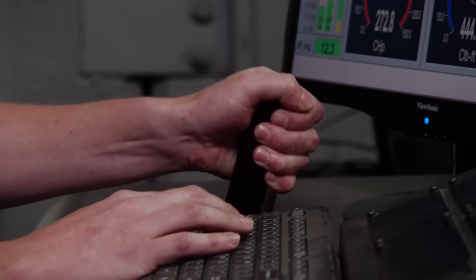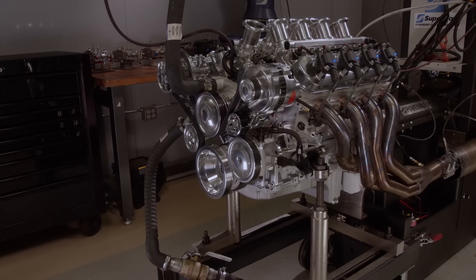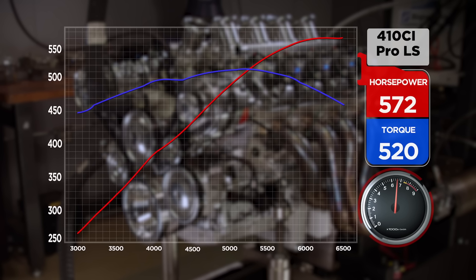Normally I like starting something like this at around 3,000 RPM, and with how far the cam is advanced on this one, we'll run to 6,500 for the top end. This thing's not going to turn a bunch of RPM because it's a street engine — we jacked the cam pretty far forward to keep the power in a manageable, low RPM range. So we're going to go 3,000 to 6,500 at 300 RPM per second. It loads right in. 572.1 horsepower right at 6,400 RPM! 520 pound-feet of torque. That's a nice torque curve too — over 450 pound-feet everywhere on the graph. 520 at 5,100 RPM. That's a great street engine curve right there — nice and smooth with no weird holes in it.